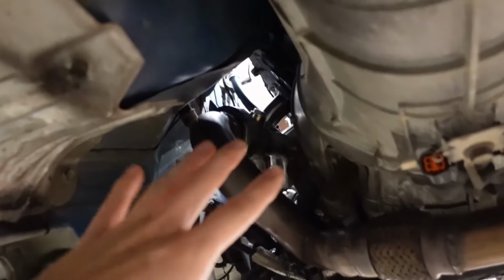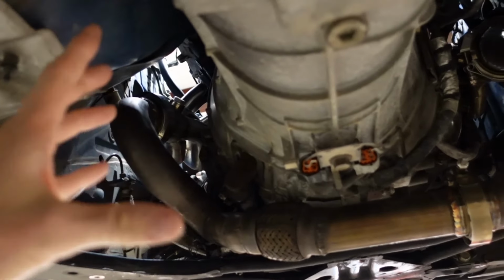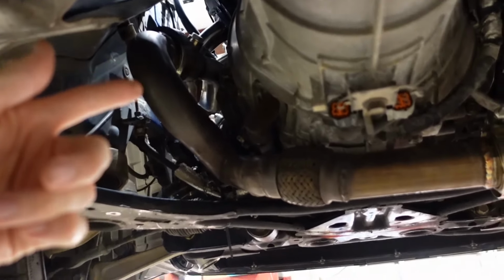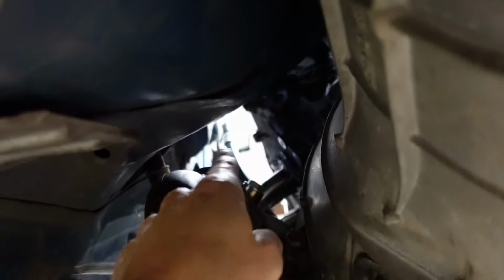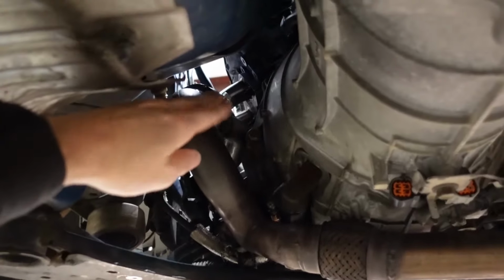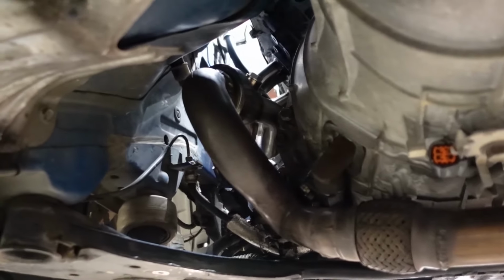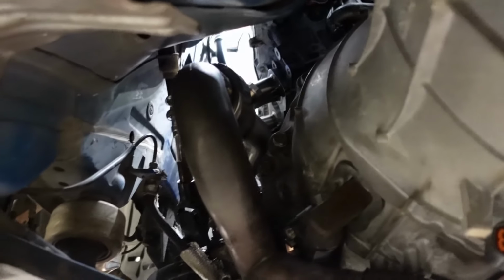I got to looking at it last night and I wasn't going to be able to put this header in. Typically on a Rev9 turbo kit, you can't put headers in, because it gets in the way of all the forward piping and the downpipe, nothing fits. But what I realized is I had done that coolant pipe delete. I don't have the heater pipe up here. So my downpipe sits a little higher and comes over close to the transmission and down more than the normal downpipe when I had built it for the 3-inch. So because I don't have the coolant pipe there, I actually think the path I picked for my exhaust might fit.